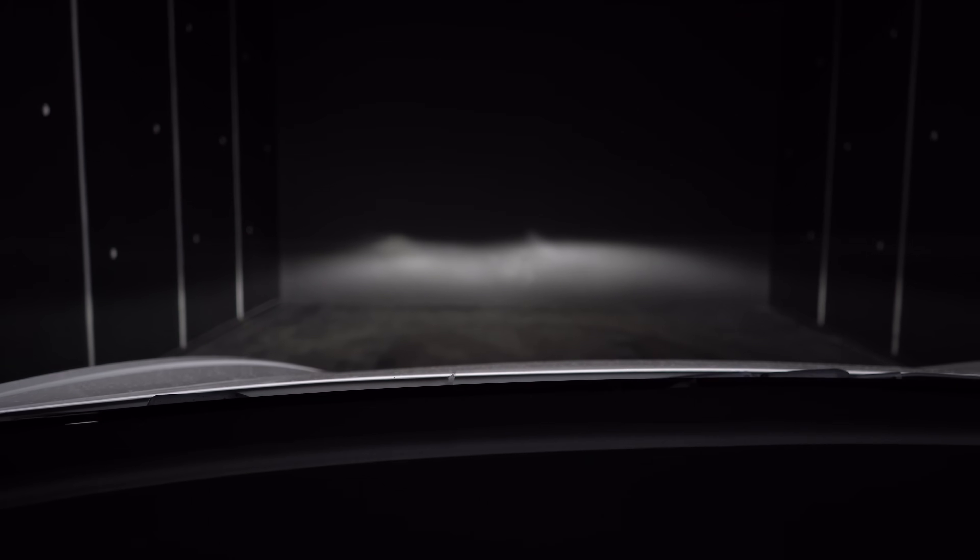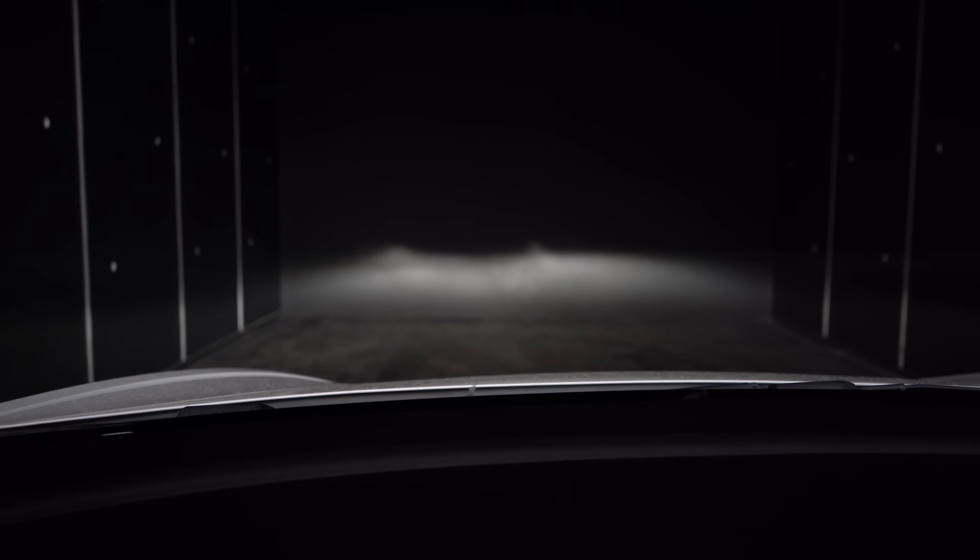It comes out of the calibration menu when I go backwards — that's why it went black — and it's just slightly going off to the left now, which is about right. So fundamentally I've checked that the car has the headlights pointing downward slightly and off to the left slightly, which is good. The best way to test this now is to get outside on the road at night.